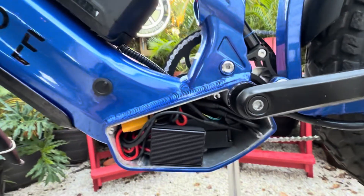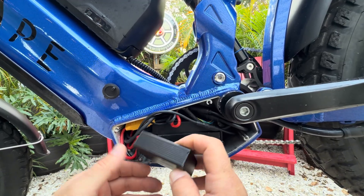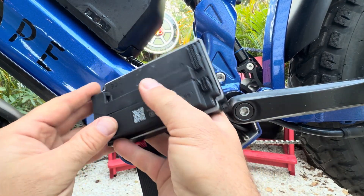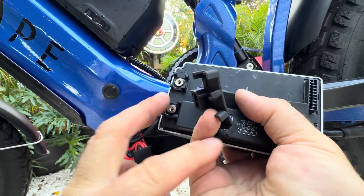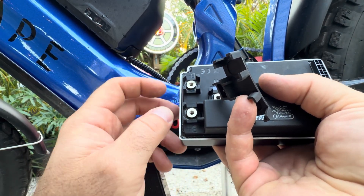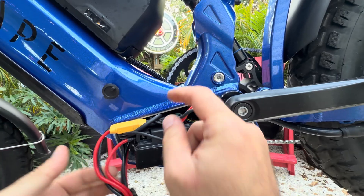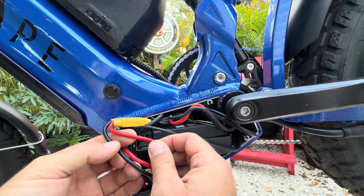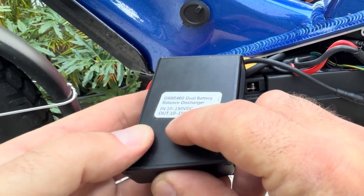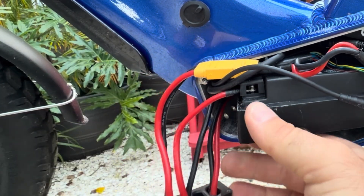We are in. First things first — you're going to see the balancer stacked up front with everything. This is particular because it connects to the controller. The connections are actually pole-mounted, and there are two connections for the Bafang controller where you actually put the screws through and it fastens the wire to the poles on the controller itself. You're looking at, I believe, 12 AWG wiring for this balancer, and it is a 10 to 150 volt DC, max 60 amp current — the same max as the battery, so these are paired to the battery.